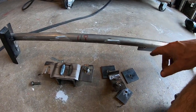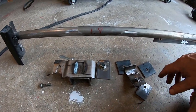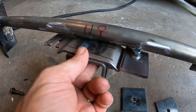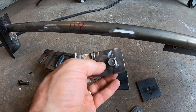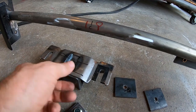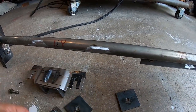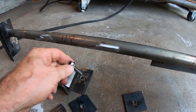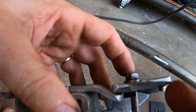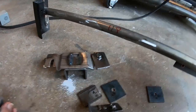I took the steering brace thing out for the first time since I'd added the middle — that went pretty well except I pushed to put the bolts on the other side, but I got it out. I cut off the old mounting tabs and I can actually push this thing back almost two and a quarter inches, so I'm going to push it back two inches. I made new brackets twice — I can almost reuse the old ones except now it's going to be on the bump instead of in front of it, so I need bigger brackets. I made them again. I hope they're thick enough — I should have used thicker steel. Three times I've made brackets for this thing.